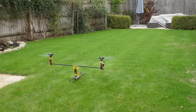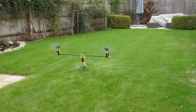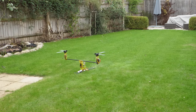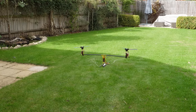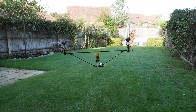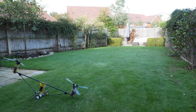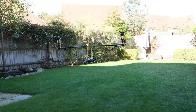But then I noticed an odd vibration that would suddenly appear and then get so violent that the aircraft would suddenly drop out of the air. My theory was that the blade RPM was reaching a resonant frequency with the wing spar, so I added some nylon string to try and stiffen the frame. Unfortunately this didn't help much, so I then added some extra carbon fiber braces, which made a significant improvement and it was finally able to get off the ground and into a hover. Though it was obvious the vibrations were still there, I tried balancing the rotor head and blades as much as possible, which did make a small difference, but it's not completely gone yet.